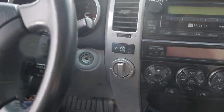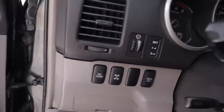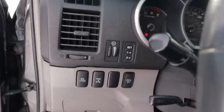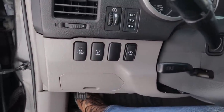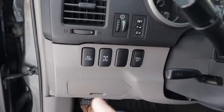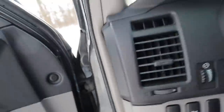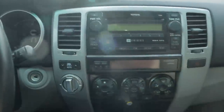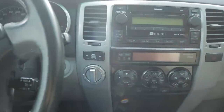It's basically that easy. Now, one thing I like to do is whenever I do my monthly use it or lose it ritual is I'll cycle the center diff lock as well, which, by the way, we're going to talk about in a second. And then I also I'll give the parking brake a press as well. Just because, I don't know if it's that important, but those things aren't things that I personally use that often.